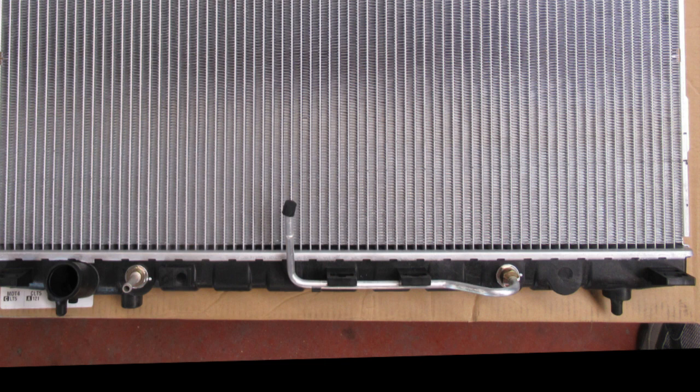This is just a close-up of the two metal lines that go to your transmission oil cooler. Be sure that your oil cooler rubber lines are in good shape — mine were. At the bottom you have the transmission oil cooler lines, also a bracket that screws to the radiator that holds one of the transmission oil cooler lines, and of course you have the lower hose.